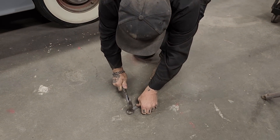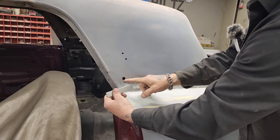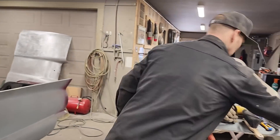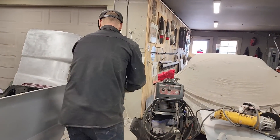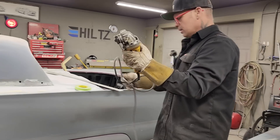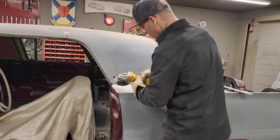I'm just going to tap these pieces in — stick them in from the back side, give them a little spot, then weld them in solid. No harm no foul, because inside with the headliner recovery, you're not going to see it. Nothing's getting in behind the piece I stick in there. I'll be happier with that gone — no doubt in my mind. You don't have to put it back on the car and it looked a lot nicer with clean paint than it will with spotted, air-rusted metal.